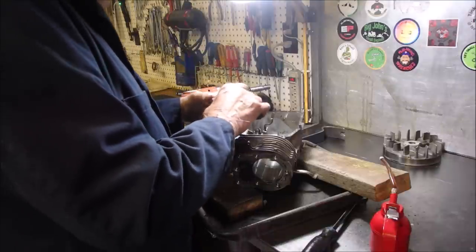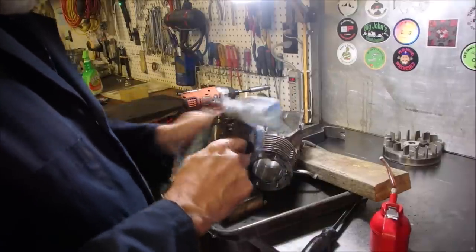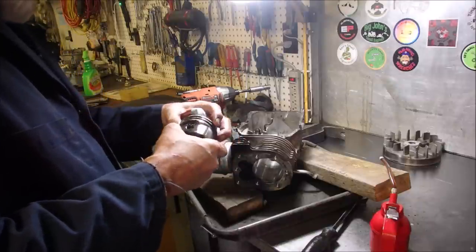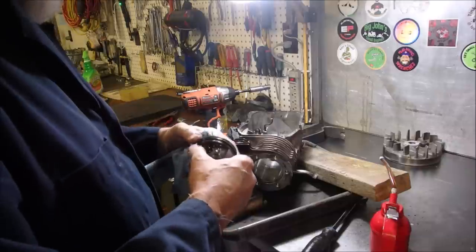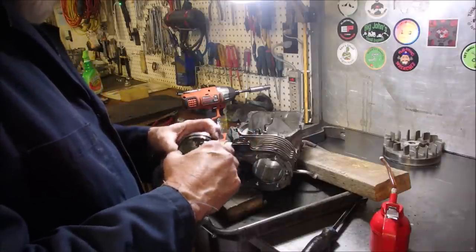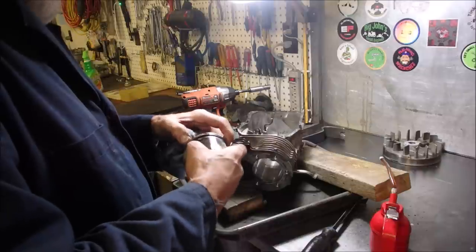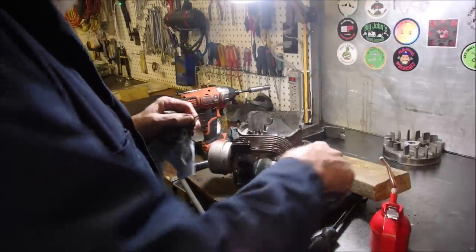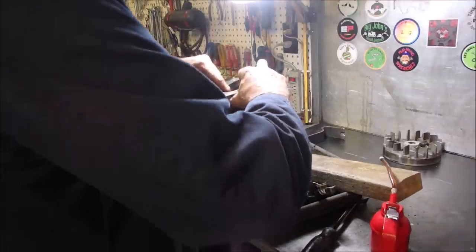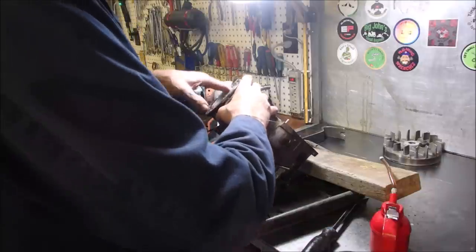Everything looks fairly good, although the oil doesn't feel right. Be right with you. Let's check the, it's a compression ring that I think is gone. So we'll take it out. It almost looks like this thing's been rebuilt, and poorly. Something's not right, eh? Okay, I'm just doing a ring gap check. That's about right. No, I don't see anything wrong with it.